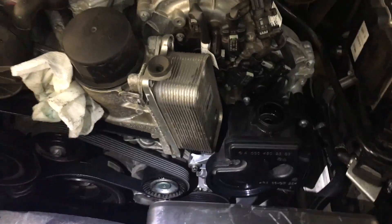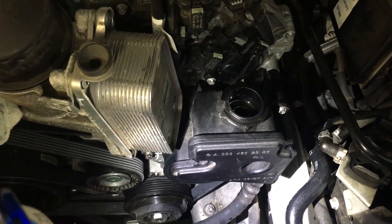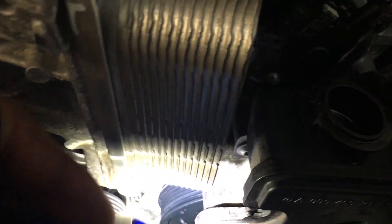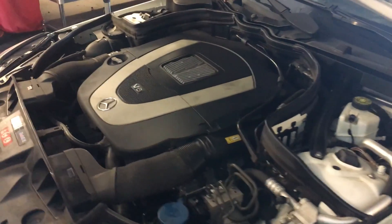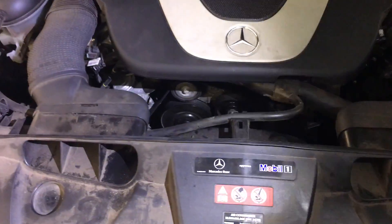Okay, pump is installed, belt is installed. It's pretty straightforward — just reverse the way you did it: the three bolts on the pump, the three T30 torx screws on the front. Everything is done. I put the engine undercover back on — which you don't really need to take out, I just did it to clean everything up. Oil is at the right level, everything is nice and clean. I already steered the wheel left and right to prime everything in the system.